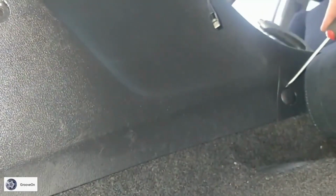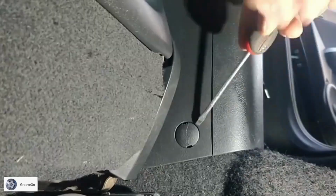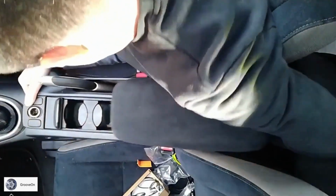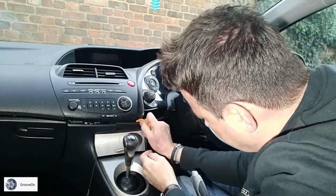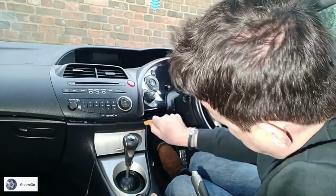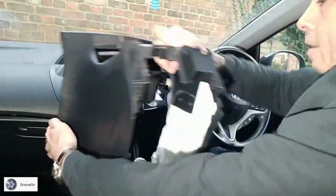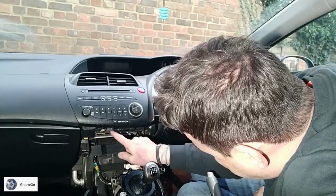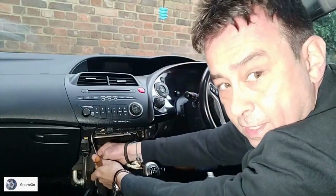It's loose. This is the one on the back. Good. And we'll see if I can slide that off. Success! Clip in the middle, and I can see somebody's tried to glue this. It's been broken before, so he's probably not realised there was a clip there, and that's it there. So that's what's stopping it. There we go. So importantly, what we need to do now is there's one here and there's one here. So let's do that. Yeah, it's the same as with the original fixing.